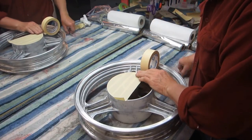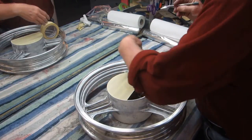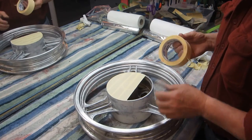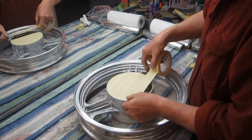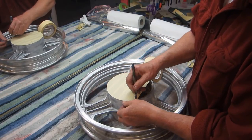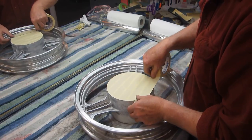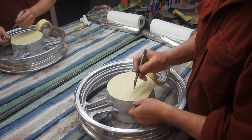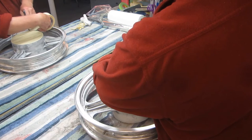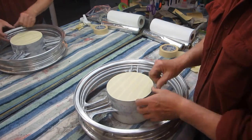Now this rear wheel took a lot more little detailing steps. The point I wanted to make was: the earlier you can catch defects — there was a little edge that needed some dressing — it's a lot easier to do it when it's in primer. You just go outside and hit it with another shot of primer. Once you have it in paint, it just gets a little more labor intensive. But right now it looks like we're going to be able to get both wheels in primer in today's session — and boy, will that be nice. We may even get some time to do some wet sanding this afternoon if the baby takes a nap — we never know about that.